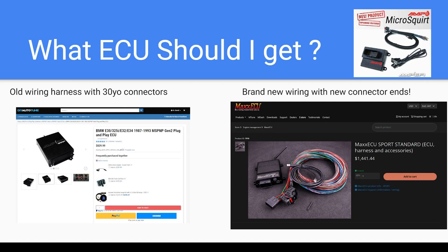It does cost more money to make a new harness, but in my opinion that's worth it — that's another reliability point of going with a new standalone ECU. You take this old 30-year-old BMW with issues with its MAF sensor, wiring harness, and little plugs to temp sensors that are all worn out and broken, and replace all of that with brand new connectors and sensors. When you buy a flying lead harness, plan on four to five hundred dollars or even more; depending on how crazy you get with your harness, you can spend well over double what your ECU costs.